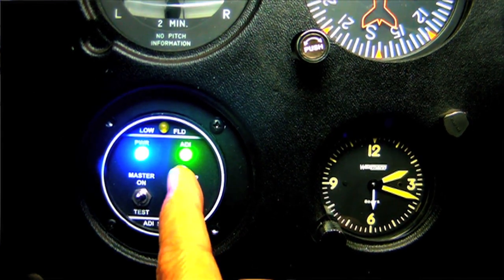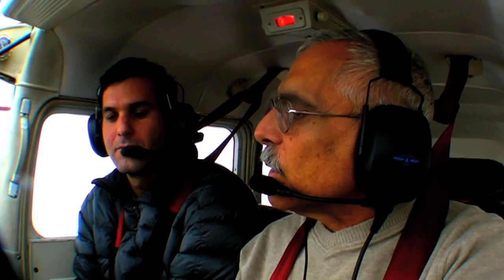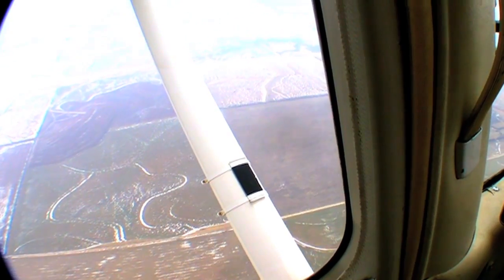As for maintaining the system, how much fluid would you expect to use? This is used primarily at takeoff, so not much. I actually forgot when I last filled it and it's been a good 40 hours. You only use it for about two minutes, and as long as you're below 25 inches manifold pressure — or on a cold winter day like today — the system is off.